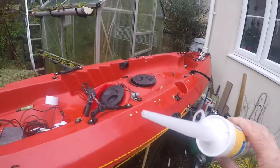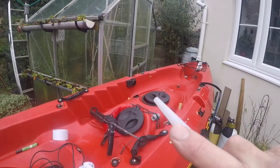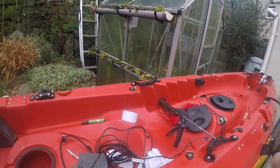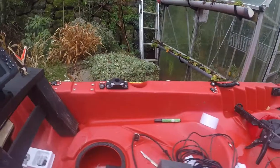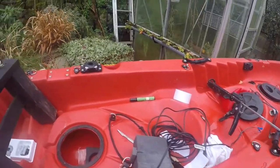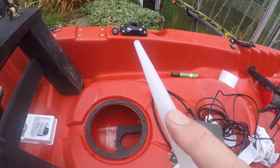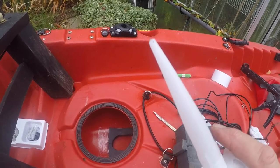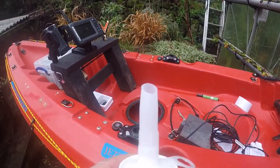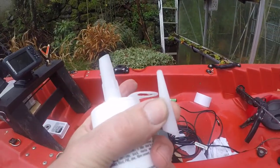As you can see the end of the nozzle is quite fine, so I'm going to get a craft knife and chop it down about halfway because that will give me a much wider spread of the silicone when I'm putting it in. One big tip: once you're putting the silicone into the mould, you do not want air bubbles — if you have air bubbles that will give you a false reading. A nice big application nozzle will give you less chance of having gaps and air.